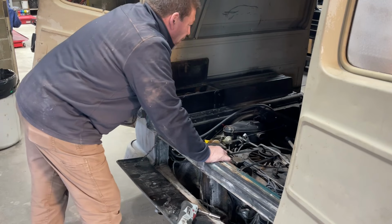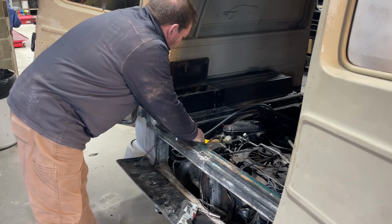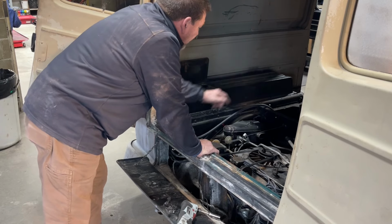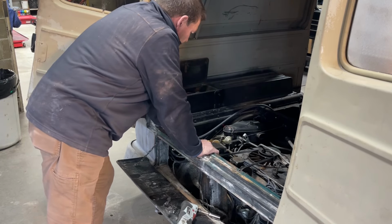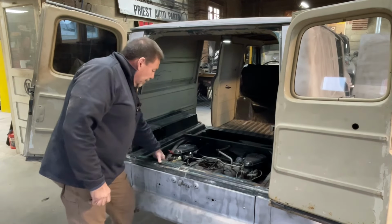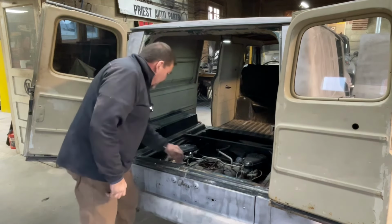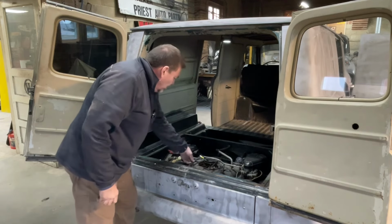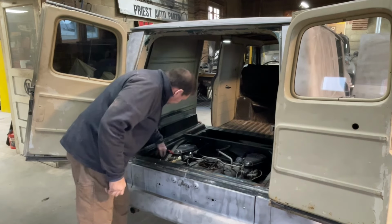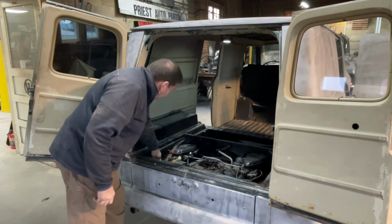All right, so I need to go get some electrical wire, some red wire, and run from the hot wire to the pump. Run it up through and hook it to that heater control switch wire. All right, I feel pretty good about that. So I've got the fuel pump hidden up underneath this channel. I did go ahead and put some lower profile headed bolts on there. For right now, I've just got the hose kind of tucked down out of the way here, and then I've got one up underneath this cavity here someplace. There it is. And the power wire running to it.